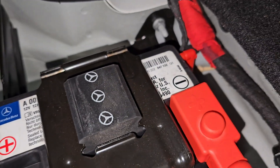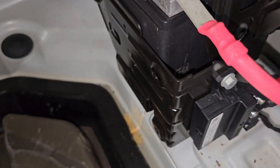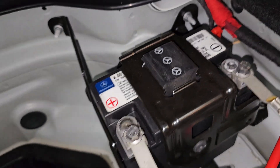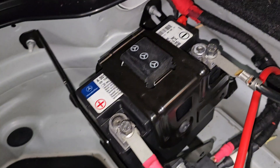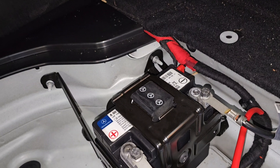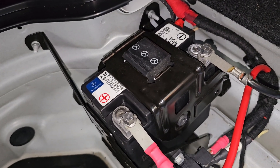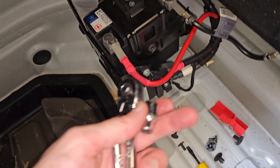It's 12 volts — it will be an AGM battery. So what I'm going to do is take the clip that is securing it, and to be able to test it I'll have to take off the connections, because if I'm testing it while it's still connected it kind of sustains power from the main battery, so it won't be accurate. I want to check if this battery is okay, so I'll just unplug those.